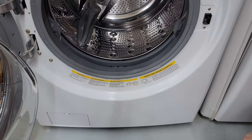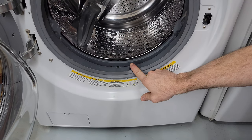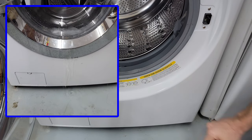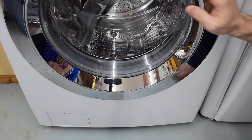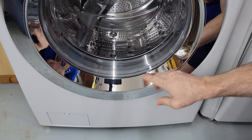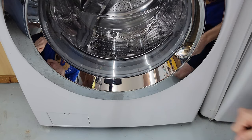First, let's take a closer look at what actually happened. This is where the seal broke — it folded over about an inch and a half onto the inside of the drum during a tub cleaning cycle, which means an empty drum but a lot more water than normal and much higher temperatures. Every time you close the door it presses against that seal to prevent water from splashing out, but down at the bottom dirt is more likely to accumulate, causing friction that makes the seal pull when you close the door. Over time it's just going to eventually crack.